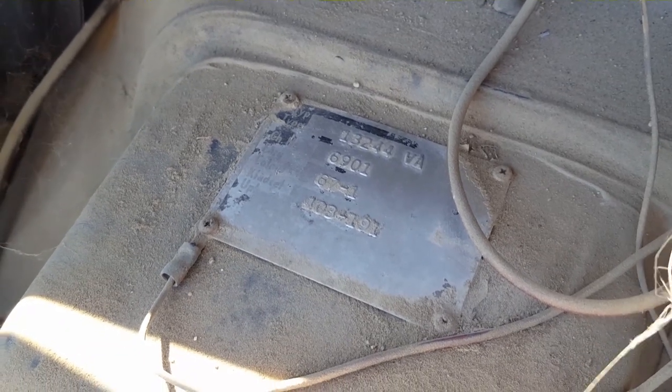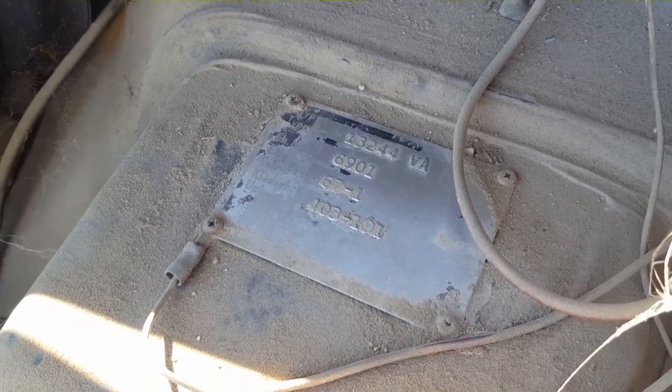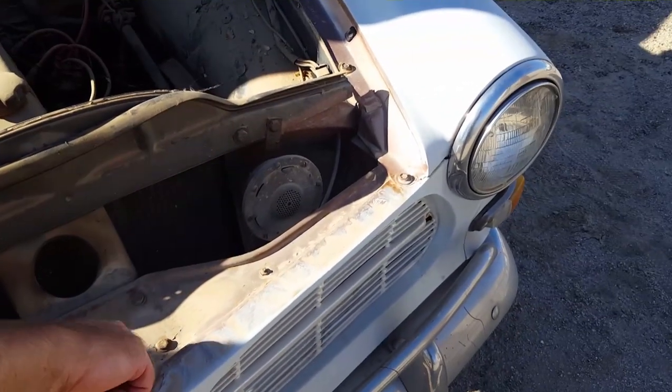The M40. Transmission. The V is for left-hand drive, and the A gives you the year. For the 130 chassis, the A code is a 1962. Could be a swapped-out nose piece for all we know. It doesn't match with the fenders.